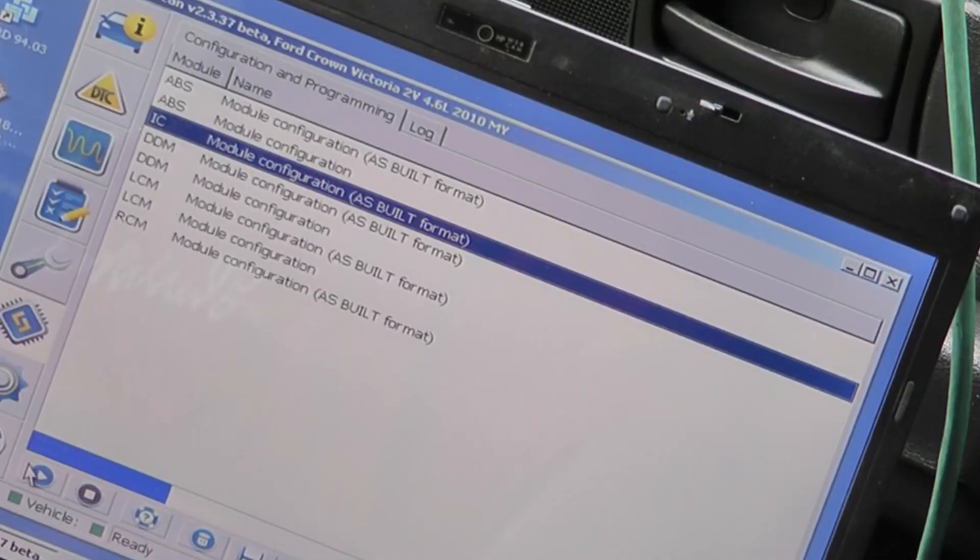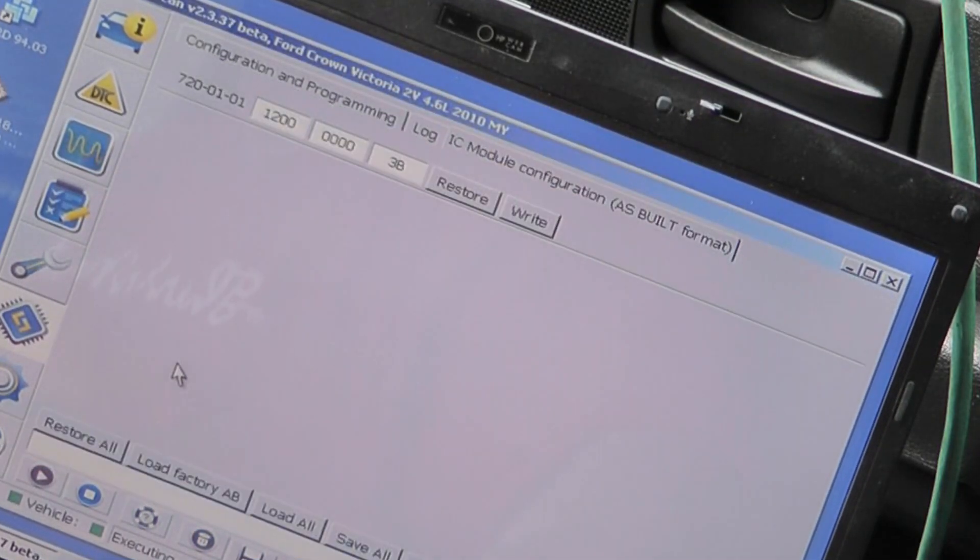This is the one that just had the one setting. I'm not sure how you get to all the other settings — the 7-2 and then this digit should give the ability to change those, but it's only letting me do the one, which is just the tire light on or off. When I say that, I don't mean always on or always off — I mean when it's on and it senses low tire pressure the light comes on; when tires are not low the light stays off. When you turn it off, the light just never comes on.